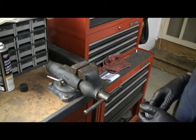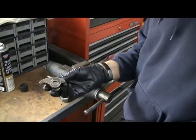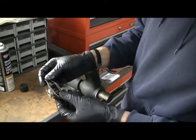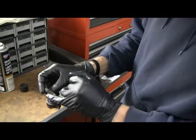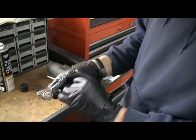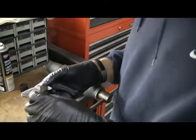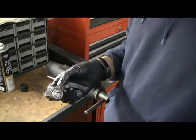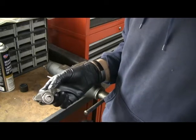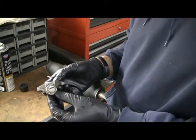One of the other things we're going to do for the valve train is to upgrade the trunnion bearings that are in the rockers. So these are the rockers here. They're roller rockers, so there are little needle bearings all around here and all around here. In the stock ones, these needle bearings aren't encapsulated. Putting in a higher lift cam and more heavy duty valve springs, there's going to be a lot of stress on these things, so it was recommended that I do a trunnion upgrade kit.